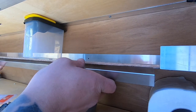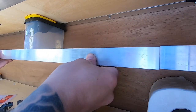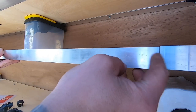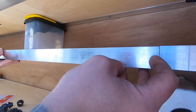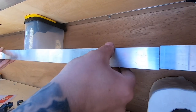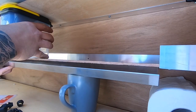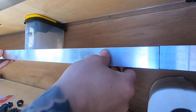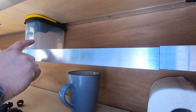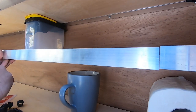There's going to be a piano hinge right the way across the bottom keeping that in place. What actually happens is they're sat in there nice and snug at the correct height. If I left them just like that, they will pop out when driving — I'll end up with coffee everywhere. So this angle closes them in there so they can't move. Then I'm going to put a little lock fastener here — a very simple bolt across at each end. When I'm ready to access my bits and bobs, I'll flick the lock open at each end and this will pivot down, offering me my goodies. Very simple. One and a half kilos — not taking into consideration the weight of these little tubs, but they weigh next to nothing. The finished amount of storage should be actually quite incredible.